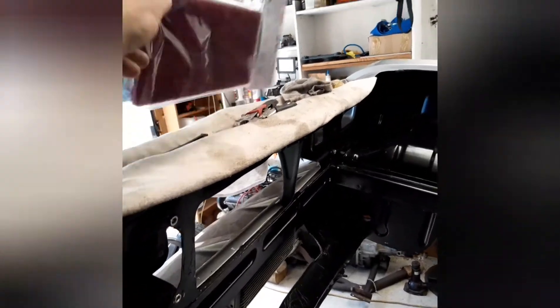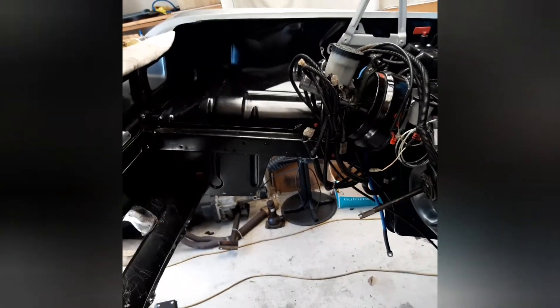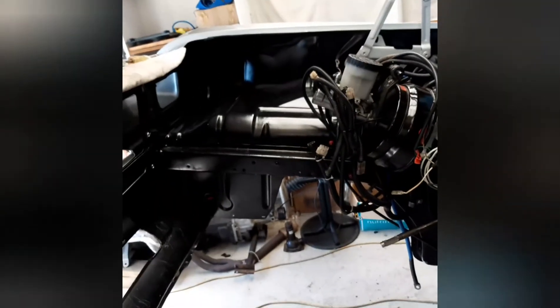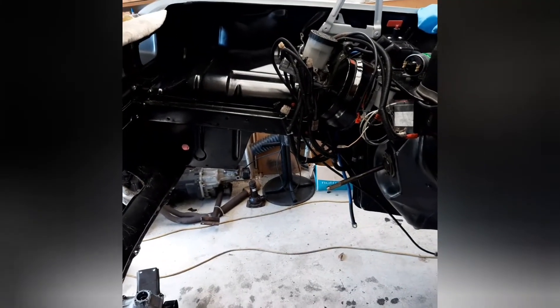The engine bay is not good enough for a gloss finish - I'd rather go for a nice satin finish which will help hide any little defects, give a nice look, and should still be easy to clean. That's my mission today. I've got some scouring pads there - I'll give this a quick rub down and mask off. I've got some paint knocked off from trial fitting the engine, so I need to tidy that up before my final engine fit, which is coming up soon.